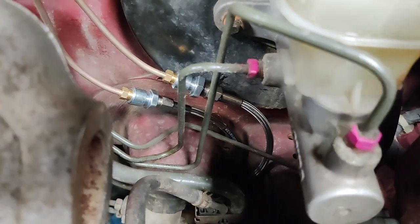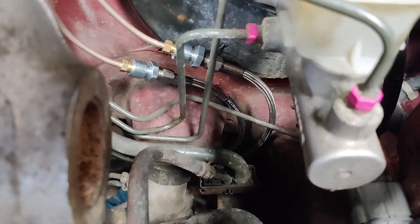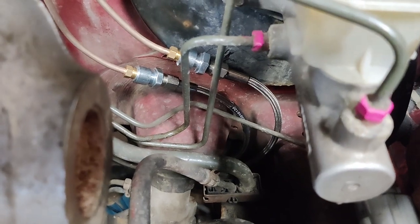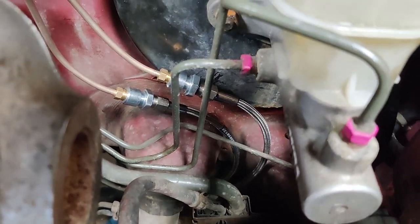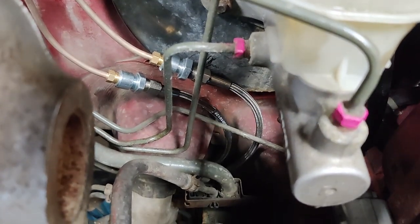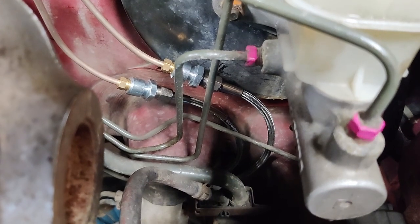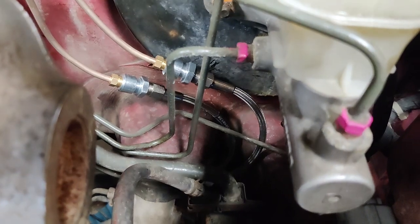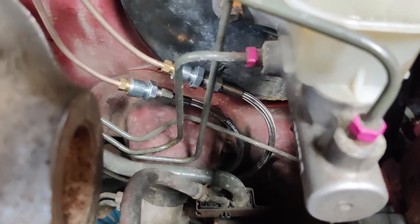The proper solution is to go between the body and the subframe, but it's kind of tricky because that path is far from straight and it's a very tight fit. To overcome it I used some braided dash-3 AN lines so I could just feed them right through. However, you don't want too much braided soft line in your system because it can make for a squishy pedal, so I tried my best to eliminate the flexible lines as much as possible.